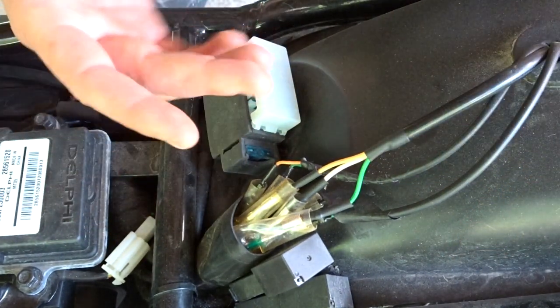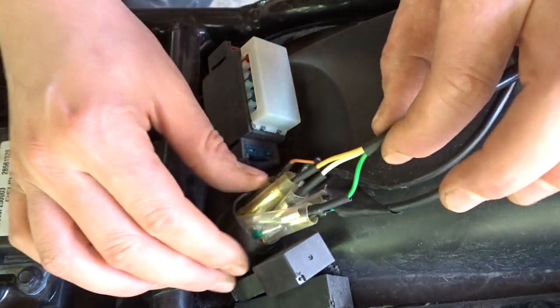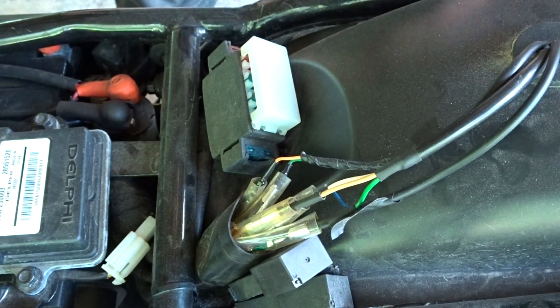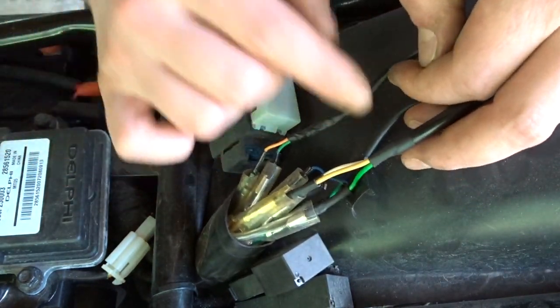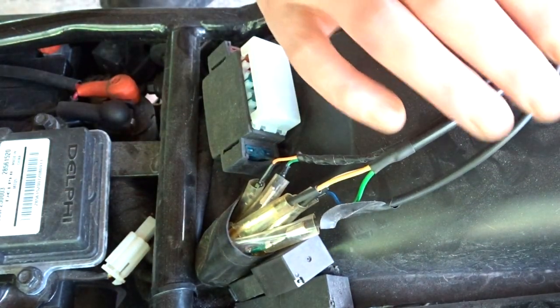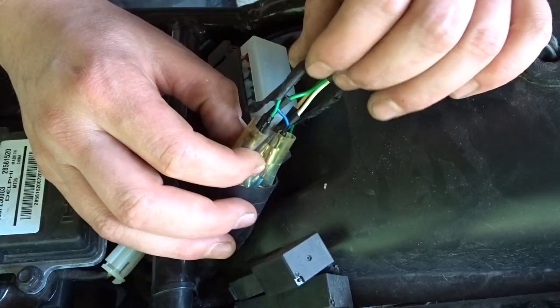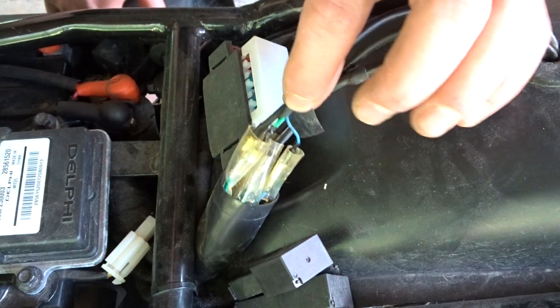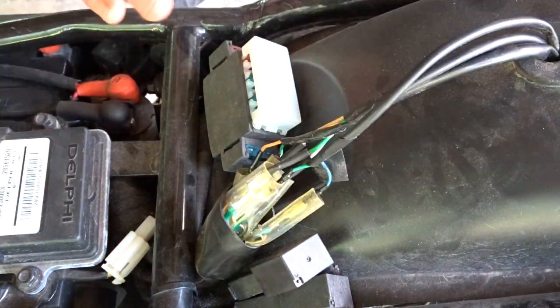When the two bolts are slid out, you can take off the seat. These are the connections for your taillight, brake light, and your indicators. To make sure which one is right and which one is left, just follow the wire and wiggle it around. It's the blue one and the green one, so now we know which wires go to the indicators.